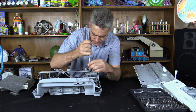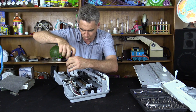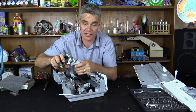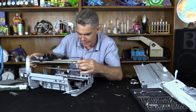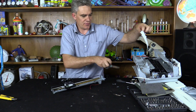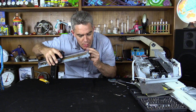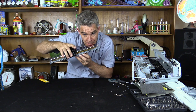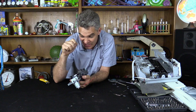Let me pull it apart. I'm going to take off the printhead running track. There's the circuit board — remove that gently, take that off. As you can see, that runs up and down, and as it does so, it turns the electric motor. All I need to do is get an LED light connected to that, and I think we might be in business. Wouldn't it be great if I can find an LED in the actual printer itself — somewhere near the control panel?